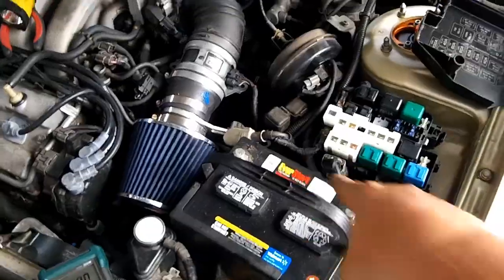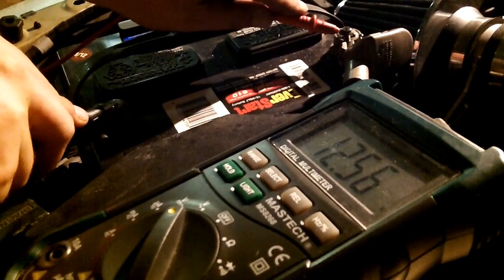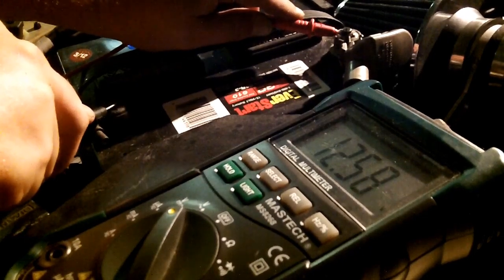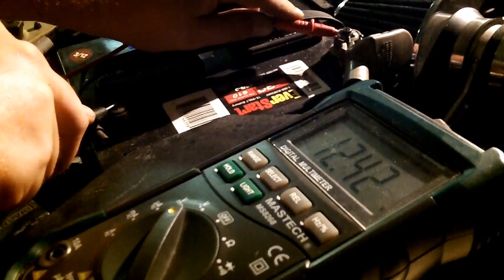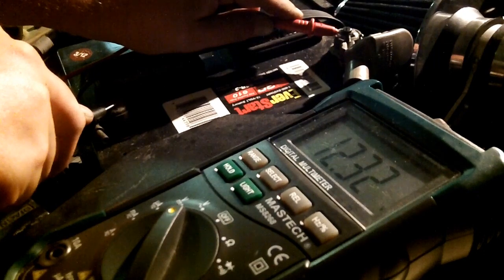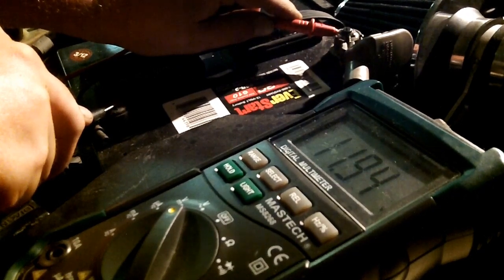Make sure between tests that you take off those battery terminals — you don't want to get fried. The charge light is barely illuminated right now. Currently our voltage is 12.56, so the charge light is not on. As soon as you put a load on and turn on the lights, we're dropping down to 12.3 — at 12.3 the charge light should start to come on. With the AC on it dropped to 12.1 and the charge light came on momentarily, then 11.9 — now it's on.